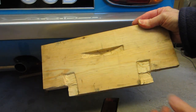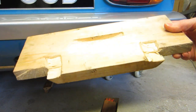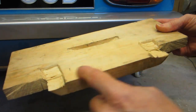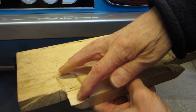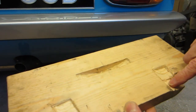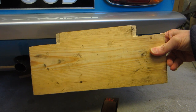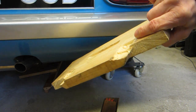The key part to jacking up the rear is this block of wood, which is cut to fit under the rear A-frame. You'll see this weird shaping — that's to make it fit inside the inside of the wheel rim, and then just reduce the thickness here because this is where the bushes fit in, which is slightly deeper than the rest of the A-frame. The idea is to support the bottom hub and the rear A-frame, and not damage the rear brakes, by having clearance for the brake disc.